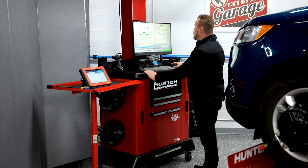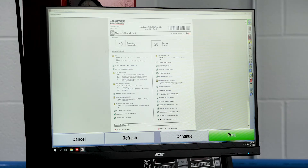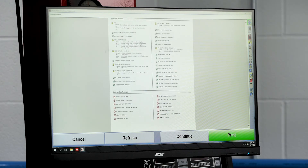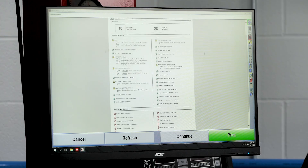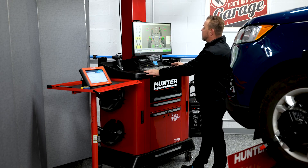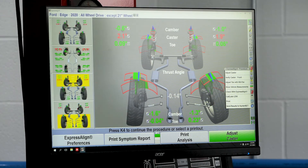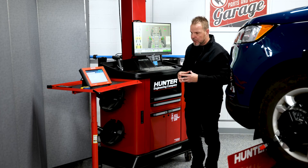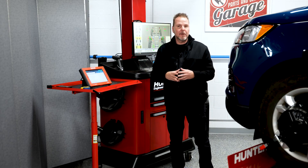Once you're done printing anything you want to print out, you'll press cancel. Now this is my report from our ADAS link — all of the modules that were scanned and any DTCs that are present in the vehicle right now. You're going to want to print this off along with everything else from your blueprinting to provide a complete analysis of the vehicle and all issues that may be related to it. Once you print off your ADAS link report, it's going to bring you back to your screen with all of your Express Align procedures, ultimately ending up with a calibration if needed. This is all of our blueprinting pre-scanning procedures — anything that would need to be done, whether an alignment or a calibration, would be done after that.